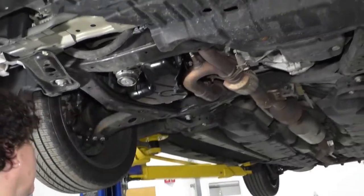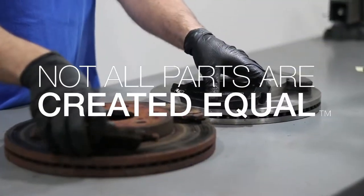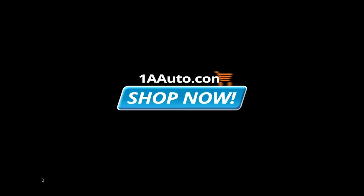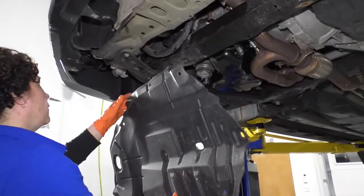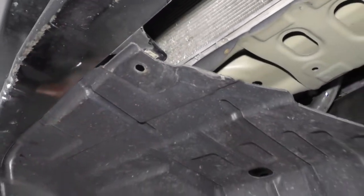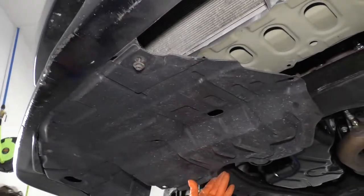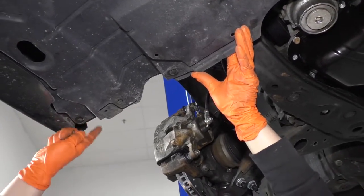There's the R for right side, passenger side. You can see the cutout of the fender well right here, so I'm going to guide it in. You want the tab from the bumper underneath, and you want to put all these little flares up under like that. So I'm going to put one bolt in to hold it, and then I've got my fender guide here — that's going to go on top there, then that one.